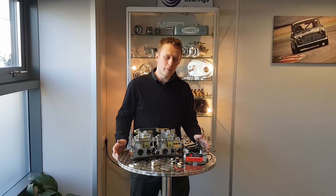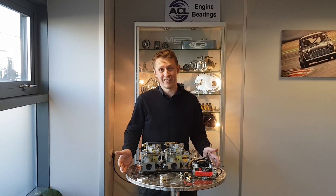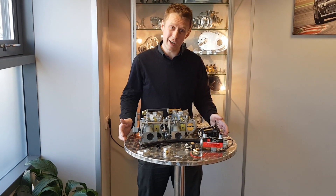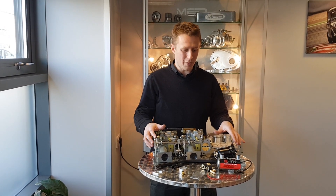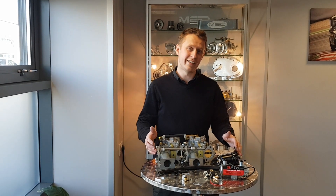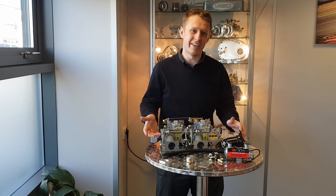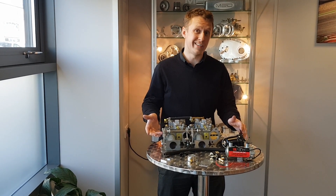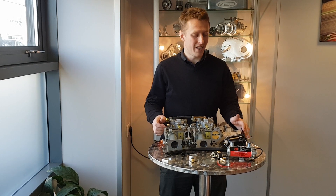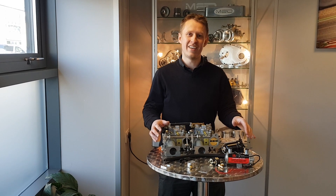So why would you upgrade from the mechanical pump to an electric pump? Like anything mechanical driven from the camshafts — like a distributor — it can wear out. An electric pump is a separate entity so it's more reliable. You've also got a huge range of electric pumps and pressure regulators available. The mechanical pump is right next to the exhaust manifold, which is red hot, so there's a risk of fuel vaporization in the system. Overall for anything high performance — road or competition — an electric pump and fuel regulator kit is the way to go.